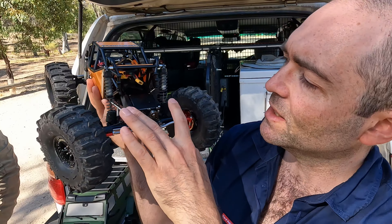I've actually been developing my own wheel inserts to replace foams — I've got the equivalent of dual stage. They're printed from TPU, and you're going to be able to find these on rctnt.com. The fronts are a bit softer, the rears are a bit firmer. I've got about five different designs, and I've chosen these because I developed them just for these tyres for this kind of truck — a fairly lightweight little body.